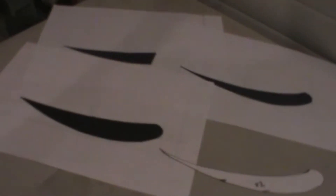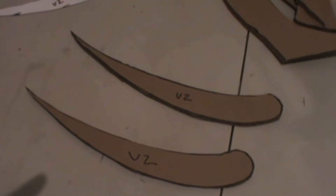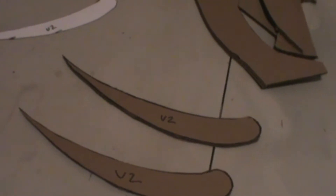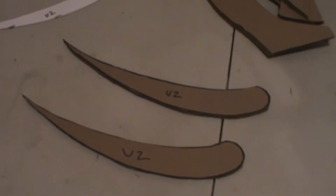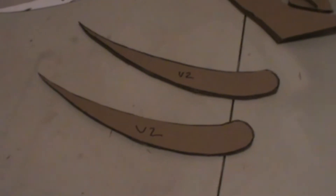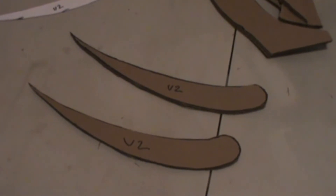There we go. I cut the two pieces of cardboard from the templates, from the drawings that I had done. So this is it. The next step will be to transfer those into a harder material like a thinner piece of wood, then sand them, make them look as good as I can, then do a template and work on the mold. The composite angle will be carbon fiber — this is what I'm aiming for — a full spoiler in carbon fiber for the rear.